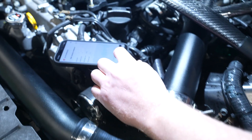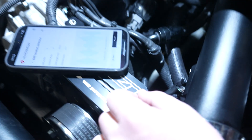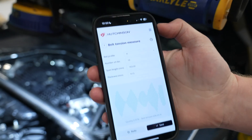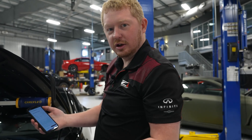Hit record — sometimes it's a little finicky. We can see here it's actually a little under-tensioned; it's only 696 Newtons. So that tells us we actually need to put a little more tension on the belt, and I'll show you how to do that now.